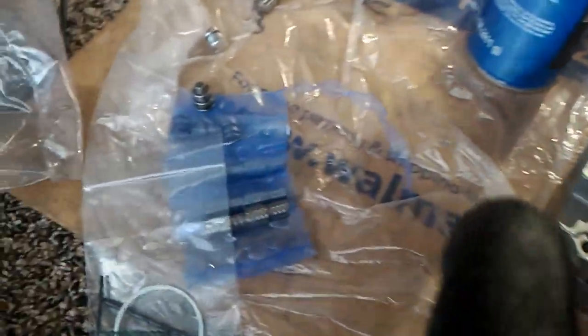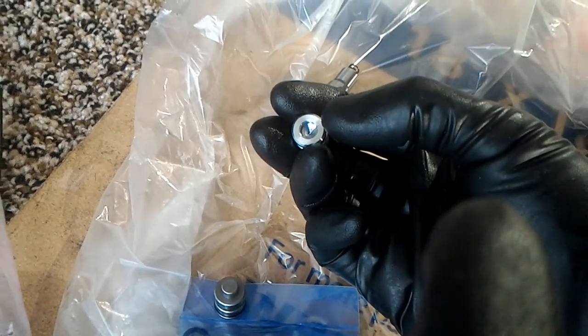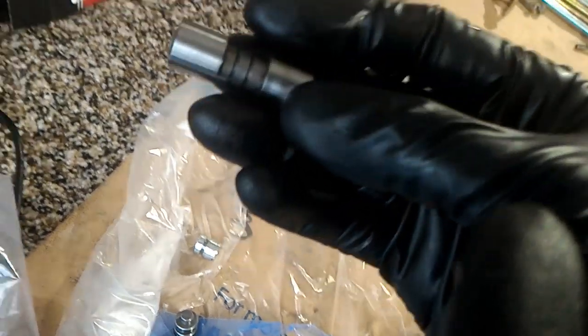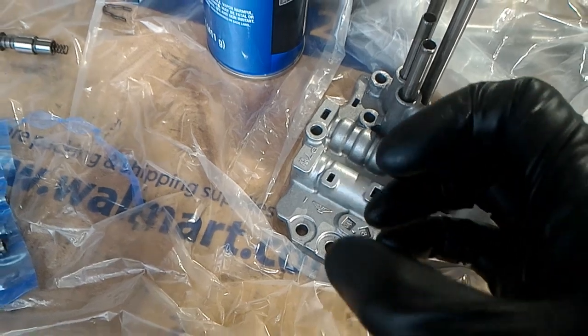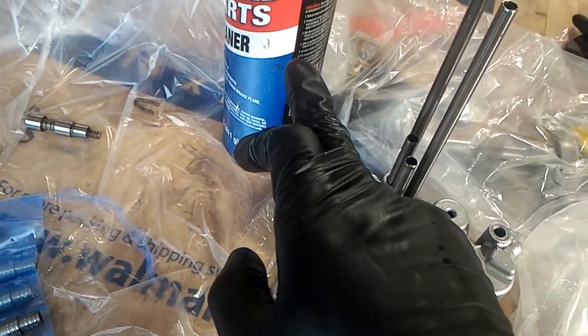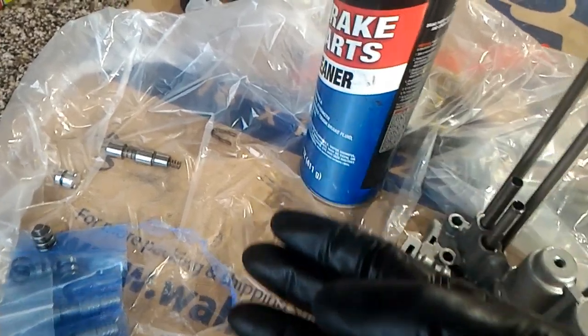Here's the shorter valve — I've already taken it out. All you do is take out the clip and take out the end plug. This faced outwards. This is the original valve and the spring was inside of it, sticking outwards towards the end plug. I noticed this is pretty scratched up. I'm not reusing it but I'll keep it. I polished the valve with the Bench Buddy just a little bit — I don't need the hole bigger, I've already tested the new valve and it's fine. Spray with brake cleaner, but make sure you don't get it on any O-rings because it'll expand them.